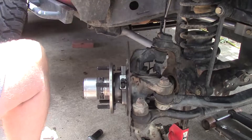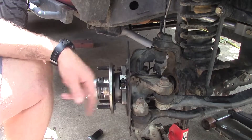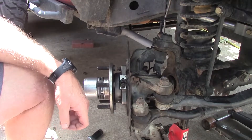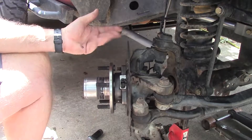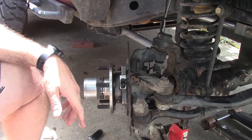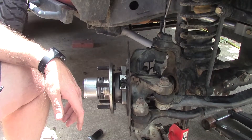How you can grease these things on the vehicle. We've modified these splash shields — or whatever you call them. These things are dorky anyway. They don't do anything. You look at any race car — Indy, whatever — they don't have any splash shields. They hold in the heat or reflect it back on the rotor. Centrifugal force throws everything off the rotor anyway. They're actually kind of ridiculous, but people are used to seeing them, so some cars still have them.